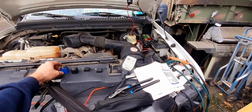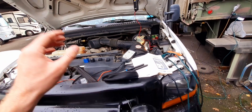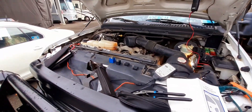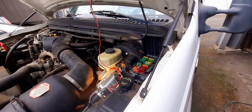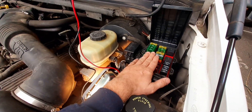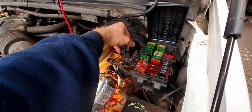He hasn't had any problems with this pickup — he's had it for years and years and doesn't really drive it. But it did this quite a while ago, maybe early on last year. I couldn't figure out what it was, checked all the fuses, ended up figuring out it is a fuel pump relay. We've checked both boxes here — we've got the main master box here with fuses, and we've got another relay box hidden over here.